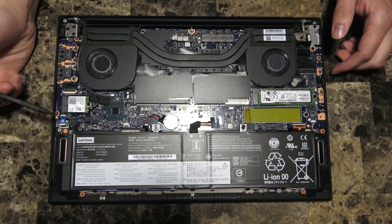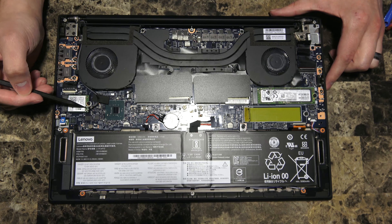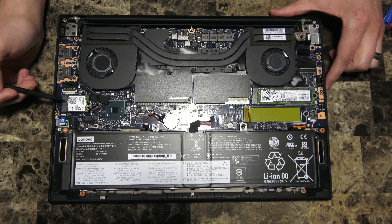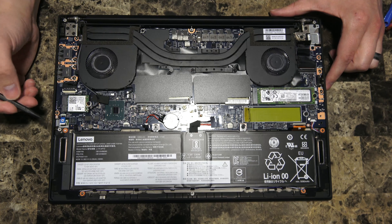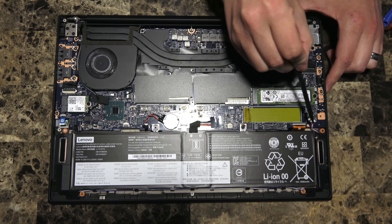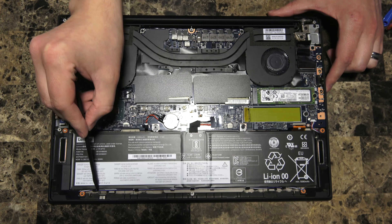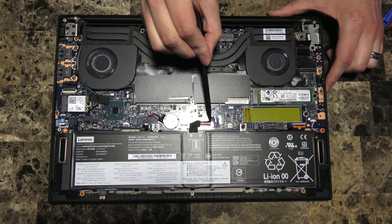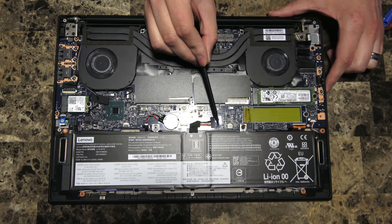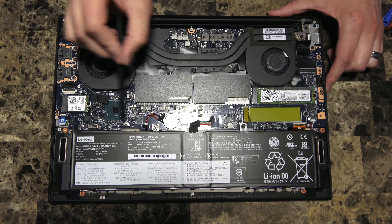For the wireless card, I'm not going to remove it as part of this demonstration, but there's a screw here just like on the M.2 drive. You just undo that, pop it up, and pull it out. There is a wire connected to it for the wireless antenna — you'll have to pop those connectors out if you need to fully replace the card. For reseating, just undo the screw, pop it up, and pull it out — it's almost exactly the same as the RAM or NVMe drive. For the battery, there are four screws holding it in place — one on the far right and three across the top. There's also the speaker wire running along the bottom, and a wire connecting the battery to the motherboard covered by tape, which is a normal multi-pin white connector. Undo the connector, unstrap the speaker wire, undo those screws, and you'll be able to replace the battery.